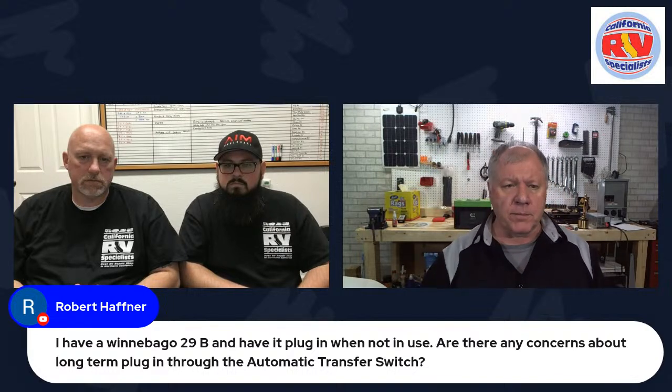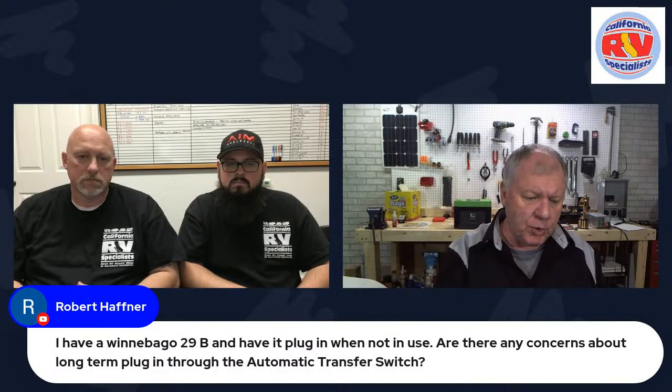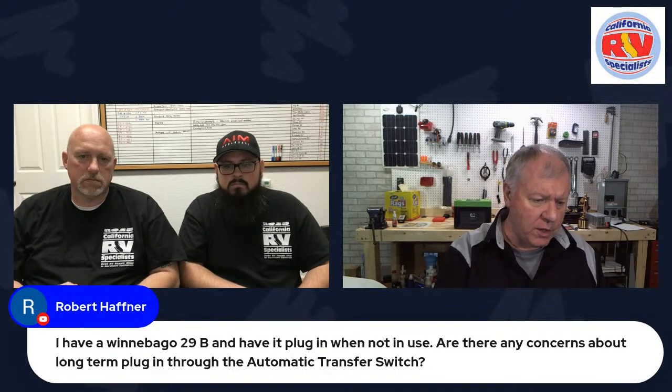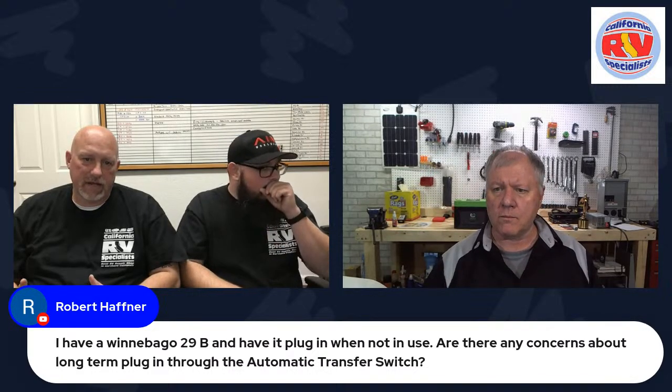But you're right. Most of what Winnebago does is they are using the Progressive Dynamics charger in those, and it will do a 13.8 charge for about 8 hours, and then drops down to 13.2. So it is a good idea to cycle those a little bit if you're able to. The bad thing about it is, for you guys that are watching, if it's constantly charging the batteries and they're not being drained down and charged back up, it can potentially dry out the water that's in the battery itself, which will then cause it to go into boost mode, which can then either catch the batteries on fire or burn up the converter.